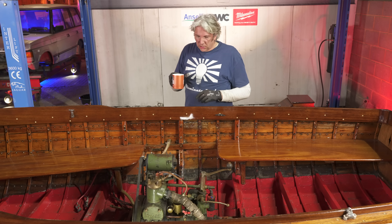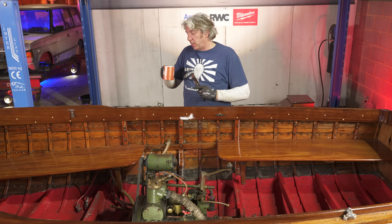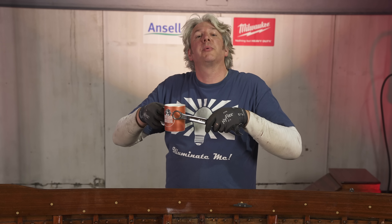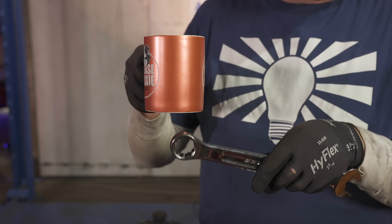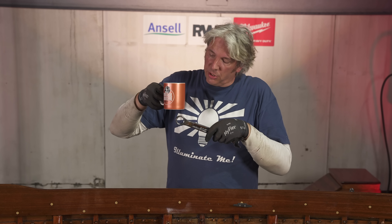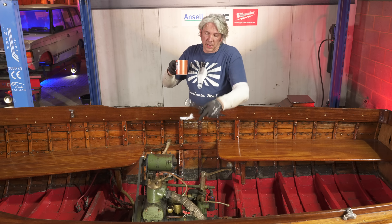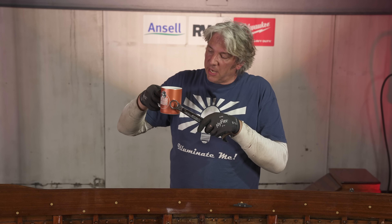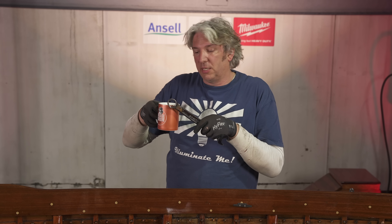So if you imagine just on the engine here, you can see the carburettor going into the side of the cylinder. Starting in the middle of the stroke — so the piston is halfway between top dead centre and bottom dead centre — as it moves upwards it's causing a vacuum in the crankcase. As it keeps going up it gets more and more of a vacuum and then suddenly it opens that port, allowing fresh air to go through the carburettor; fuel is added and that fuel-air mixture goes into the crankcase. Then when the piston comes back down again it's squishing and compressing that fuel-air mixture. On this side you can see there's this big cylinder — that's actually like an expansion chamber for the exhaust system. So as the piston comes down, compressing the gas in the crankcase, it's been driven by the explosion of the previous cycle. Eventually those burnt exhaust gases exit through the exhaust port into this expansion chamber, which allows the engine to work more efficiently, gives more breathing space and reduces back pressure.